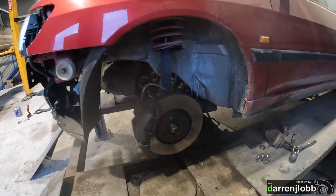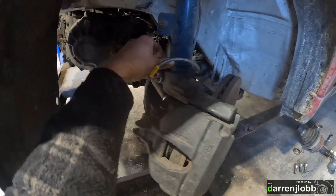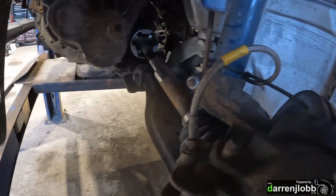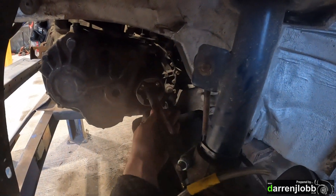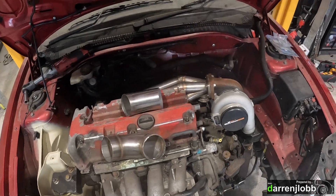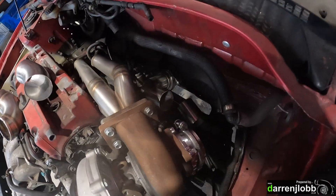I didn't video any of that, but I've just done the passenger side as well. If I just turn the wheels around, you'll be able to see a bit better on this side because there's no splash guard in the way. You've got the two halves of the shafts slid inside of each other and all the CV joints are back in - obviously it's just free to go wherever we want it at the moment. So I've got it back on the two-post now. The next project is going to be sorting out the exhaust from the downpipe and the screamer pipe as well.